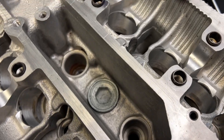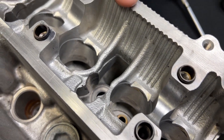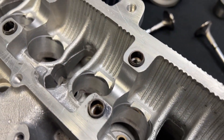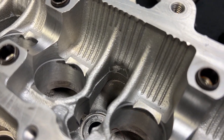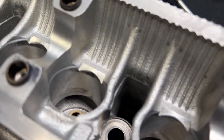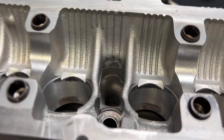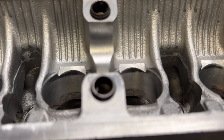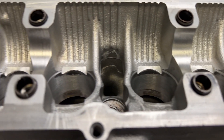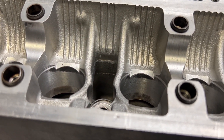That's where the problems started. Looking at the bucket holes, we haven't been able to fully explain why they look almost sanded. I can only surmise that has something to do with there being no viscosity. You can see the rub marks on the corners. Although they're not really a critical issue, it just didn't look right. But the head is completely reusable — it just needs some love. We're going to polish up the buckets and the bucket holes to make them look right.